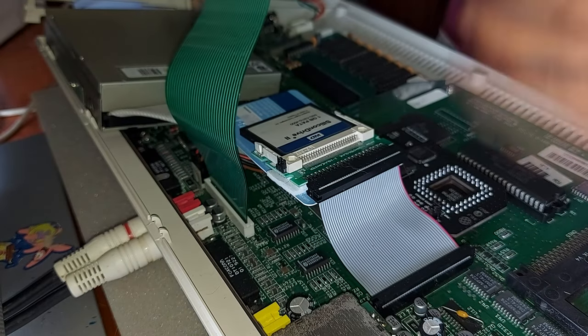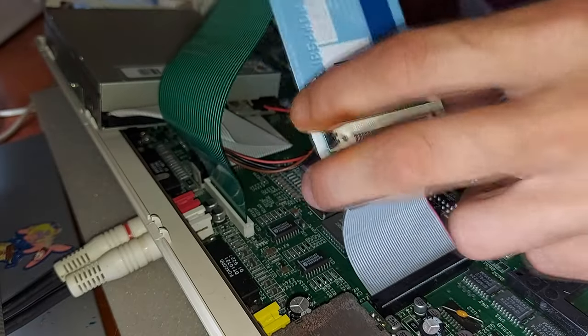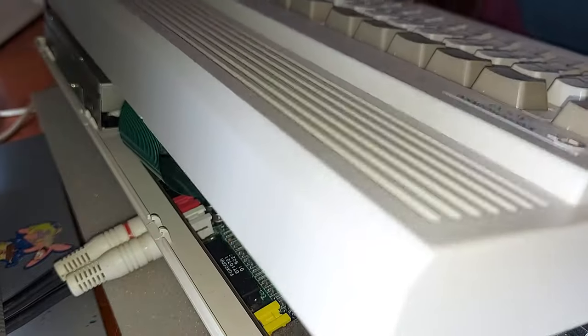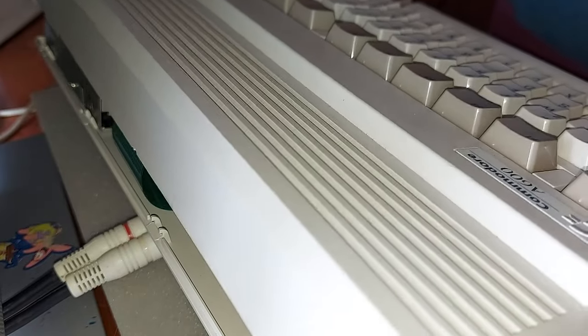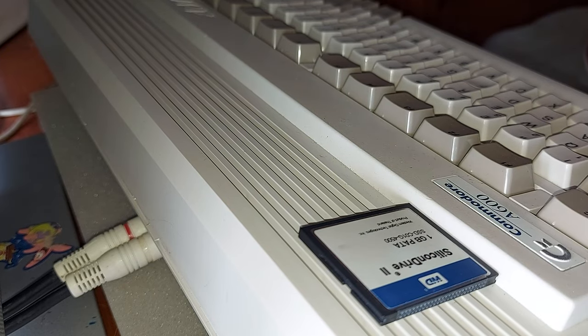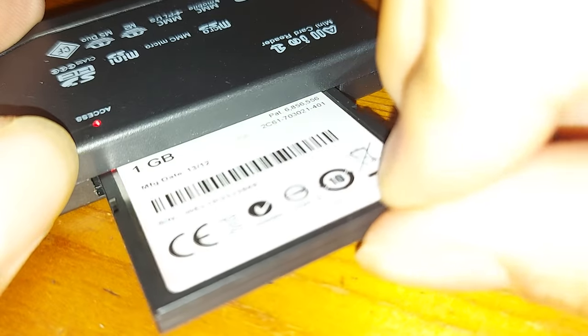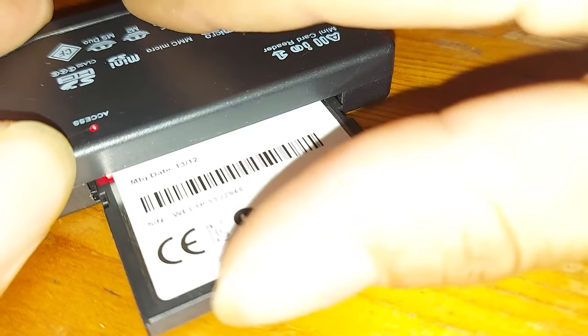In the meantime, I'd been doing some reading about the KICK34005.A500 file. Some installs use a so-called KickEmu to have a complete Amiga OS environment for the installed program. For that, KickEmu requires an original Kickstart image. This image can be extracted from a real Amiga with tools like GrabKick or similar, which can be found on Aminet. The supported image version depends on the installed program. If the image cannot be found by WHDLoad, or the image is of the wrong version or altered in any way, WHDLoad will quit with an appropriate error message.